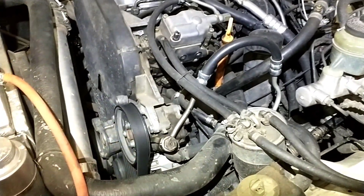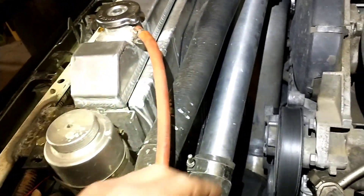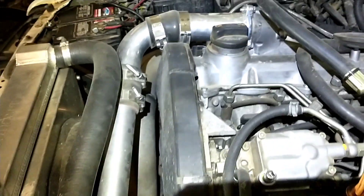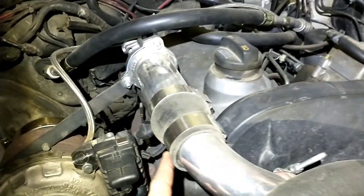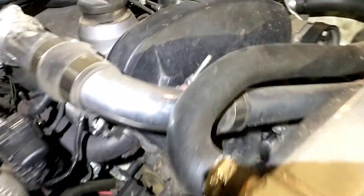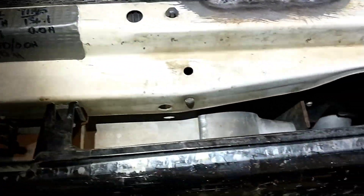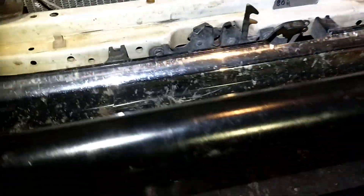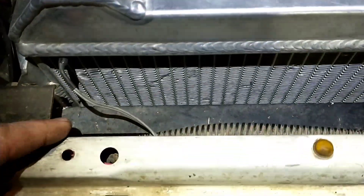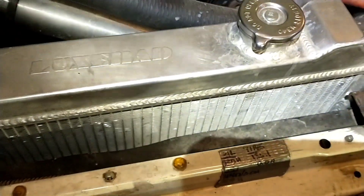There are also your heater core hoses — you just kind of have to pick and choose what works best. For intercooler piping, I've really enjoyed just using a universal kit off eBay; it gives you a bunch of clamps and couplers. Depending on which intake you've got — this is one of the BRM intakes — it works pretty well coming off the turbo. The intercooler can be a challenge to mount, but this one mounted pretty well, and I put the AC condenser inside the engine bay.